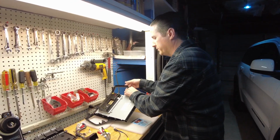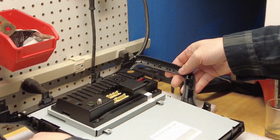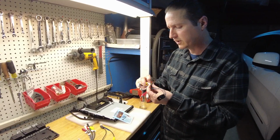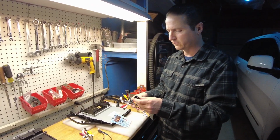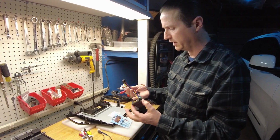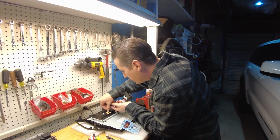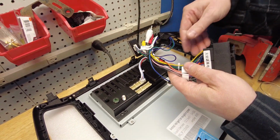So on the back side of this, just nice wire harnesses that snap right in. So that seems pretty easy. Number one is the main power. That looks like the main harness from the Jeep will plug into that. Oh wait, it's Chinese on one side and camera on the other. I didn't realize that. Some harnesses for the climate control, I imagine. This is Chinese. I imagine this is the CAN bus to retain the circuitry. This I'm unsure of. It looks like it plugs into this harness here on the right. That one is the CAN bus.